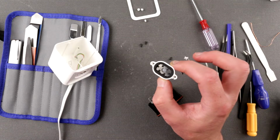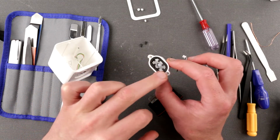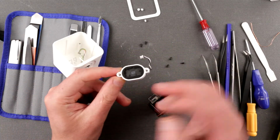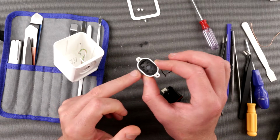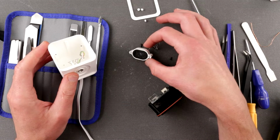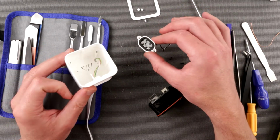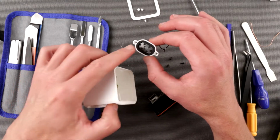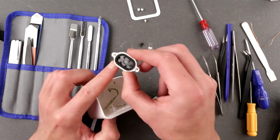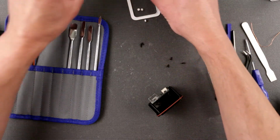If you want to make it waterproof, you better take some kind of grease and smear grease around here and work it in there. Another problem, we don't know what kind of gasket this is, so you have to take grease which is okay for gaskets, not synthetic grease, some sort of silicone ceramic based grease, which usually does not interfere with rubber like that. But something to keep in mind, I don't think this is really good waterproofing over here. So let's move on.